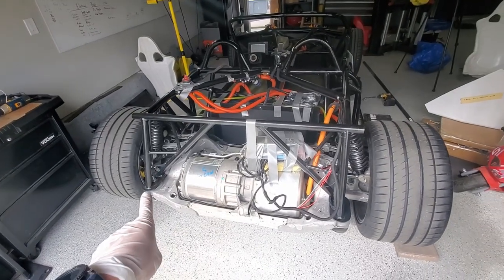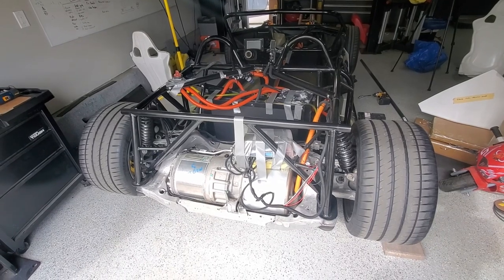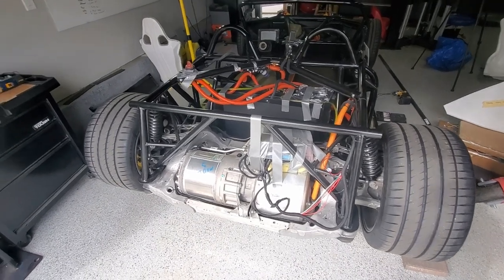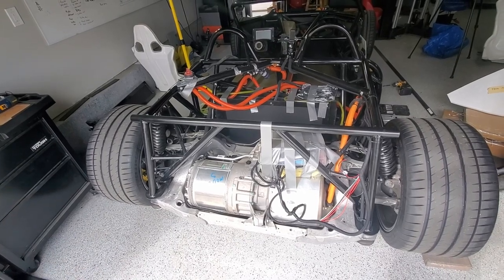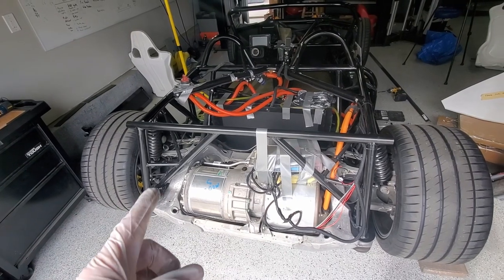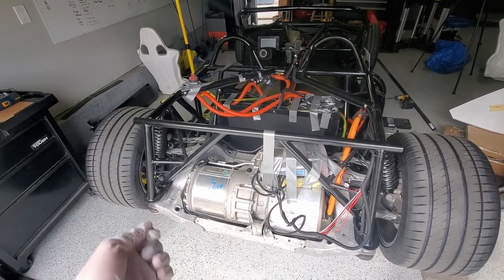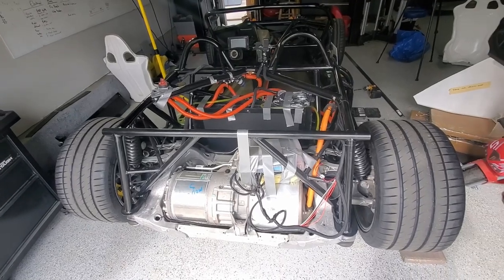I was also able to get the parking brakes to work again. So they've also given me instructions on how to make a cable that you can connect to 12 volt power just to open or close it. I guess I'll call it force open or force close. So for whatever reason if I run into this again, I can just unhook the cable, plug in the other cable with 12 volts and have it open. So I think that'll be good there.